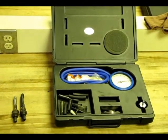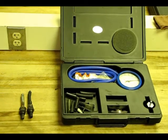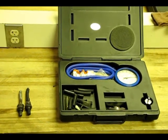There are a couple different options you have for adapters. You can use a name brand vacuum gauge back pressure gauge combo kit which comes with the O2 sensor adapter for about $150, or you can create your own out of an old O2 sensor.